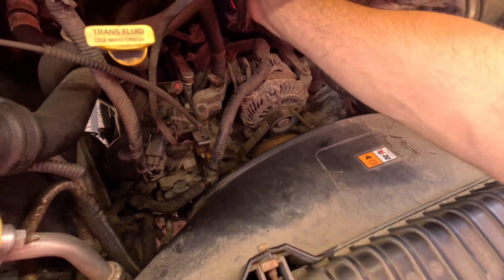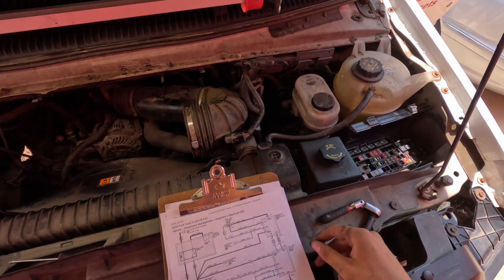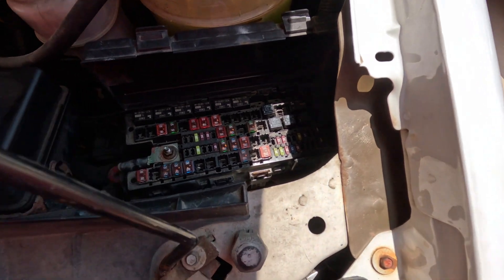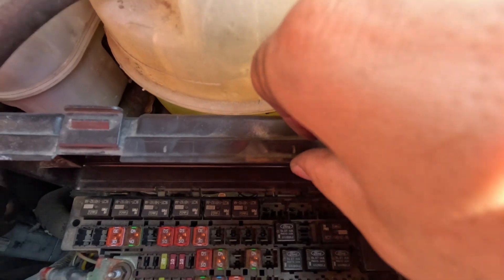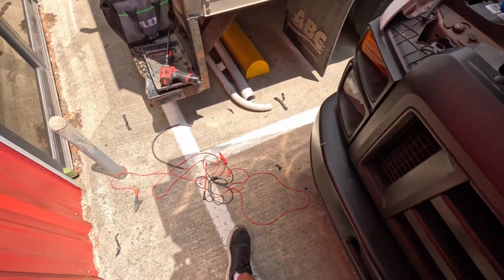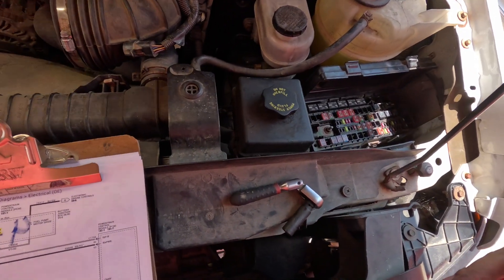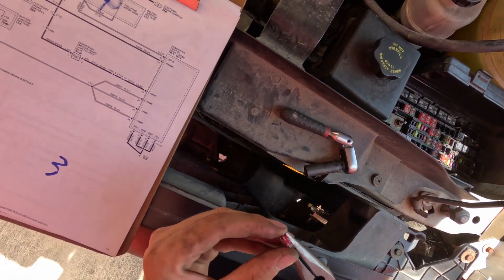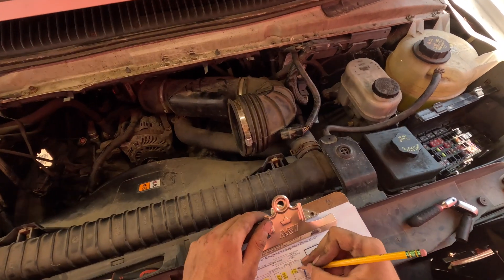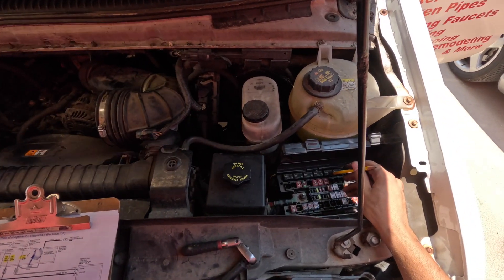It's not spewing out, so the fuel pump is not turning on. No fuel pressure, and we still have all the codes for the injectors. We need to find out why that is. We're going to check fuse 54 — it's a 25, 54, the 10 amp one. Looks to be fine; fuse 54 is good. But it doesn't look like we're getting power to this relay though.